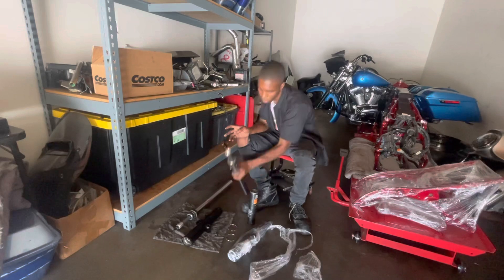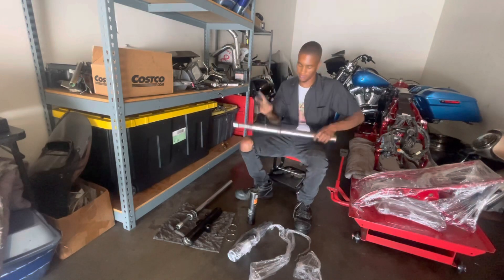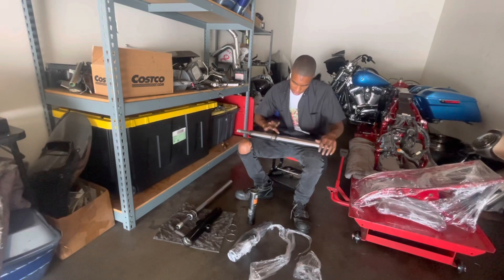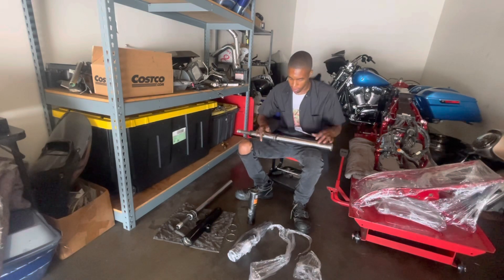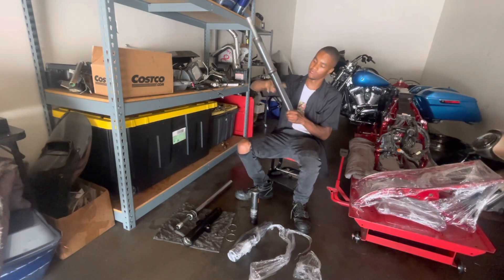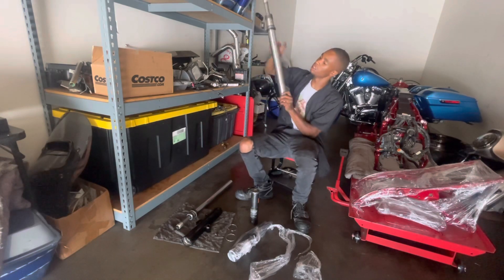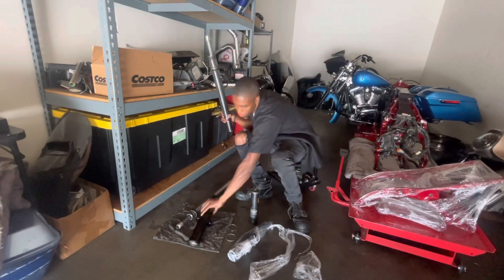I just do it around the plastic on the seal, just to give it a slippery little filler. So when we put the leg on there, it's going to go in there nice and easy — no type of difficulty. I'll put a little bit and just go over everything, here and there, just so everything can be nice and greased up. It's going to make the job easy on you. Grease everything. Now we're going to slip it right up onto here.